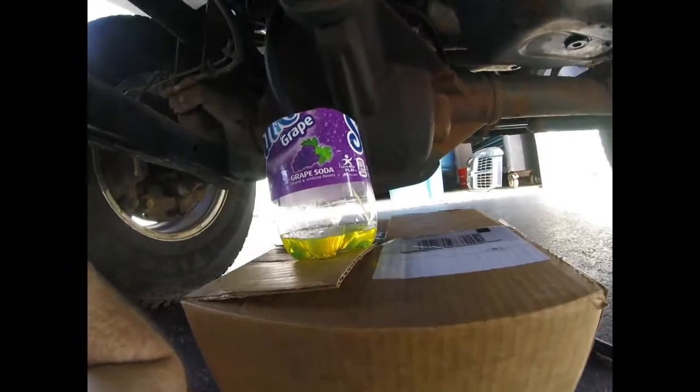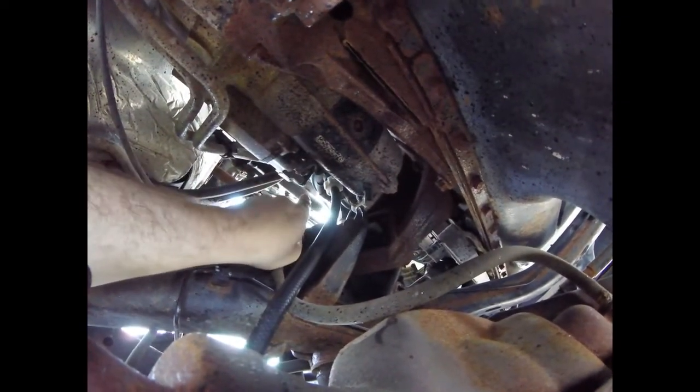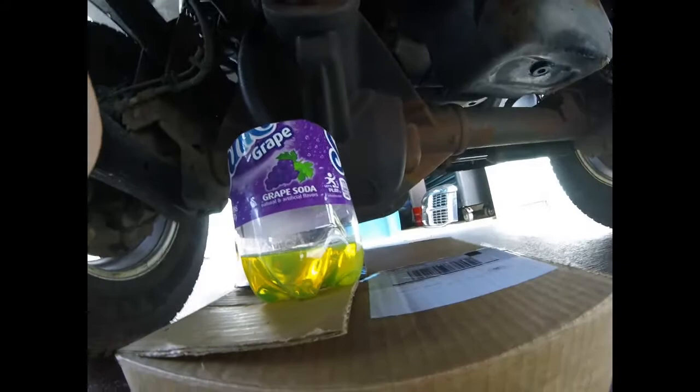First things you would want to do is drain the fuel from the original fuel filter. Mine broke last time that I did this — this is my second time doing this on this truck due to unforeseen things. So I will throw the clip in from my first time doing it here. As you can see, we've got the fuel draining out, coming from this valve up here. You have to push in and unscrew it, and then when you let go of it, it'll start draining out like that. So once that stops, we can move on.